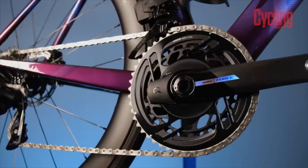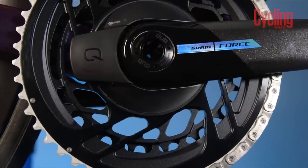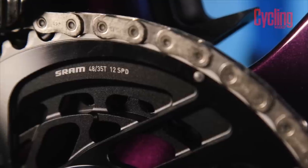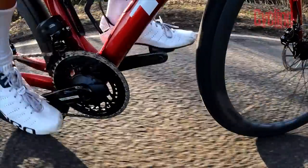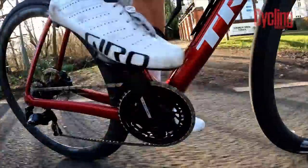I'm sure the vast majority of you will agree that it does look better. However, the cost of those aesthetic improvements may have meant practicality has suffered. We all know that chainrings are a wearable part, and after a certain amount of mileage they will need replacing. Given the new one-piece nature of the rings, when you change one, you now have to change both — much like on SRAM Red. It is slightly annoying, especially if you'd only worn down one of them with some life left in the other. You're now forced into replacing both at the same time.